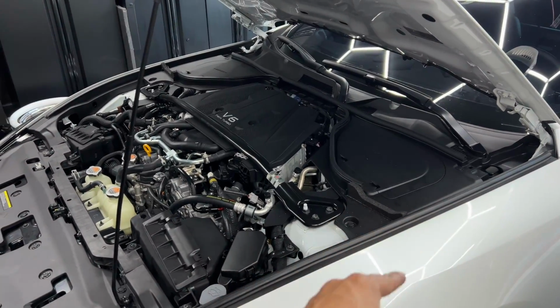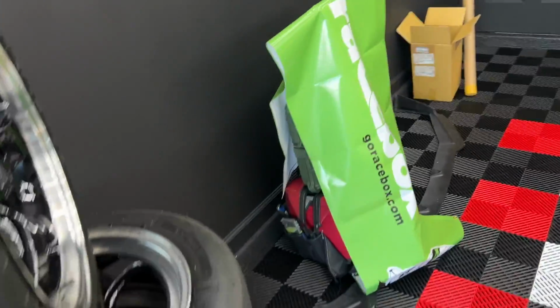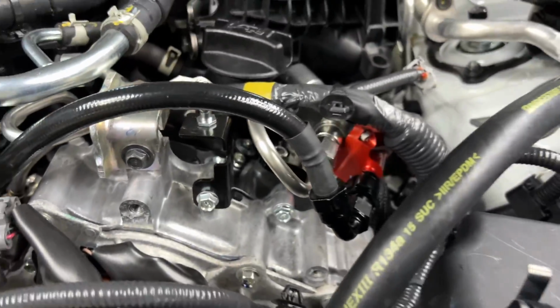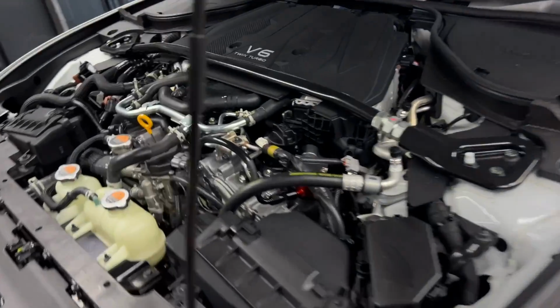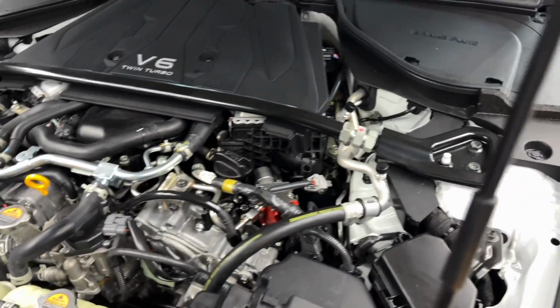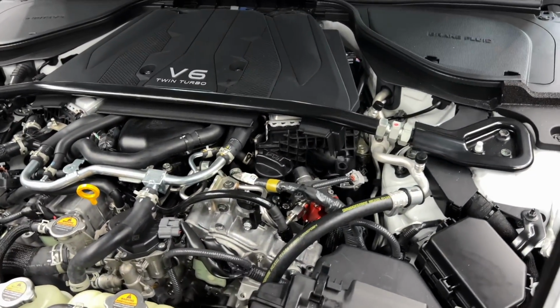All right, so the next step is turn on the car and hopefully see no leaks. Prime the pump first. One more time. Verify if you saw anything come out. And it's definitely squirting from the nut, I think. Hopefully. All right, there's no fuel coming out now. Looks pretty good to me, thankfully, because I had to turn this little red cap over to the other side. Spool sent it to me inverted.